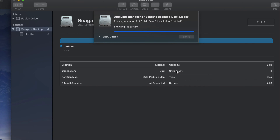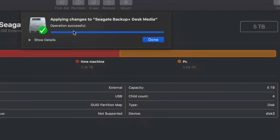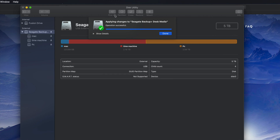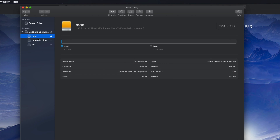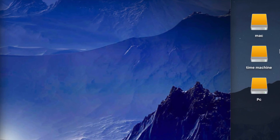It's going to read my external hard drive like it was three separate drives. If you plug this into your PC, you'll only be able to see the partition named 'PC' — not the ones named 'Time Machine' or 'Mac'. Once this is done you should see a 'Successful' message. If you get an error, don't worry — just erase it again as Journaled and start over. Then click 'Done'.